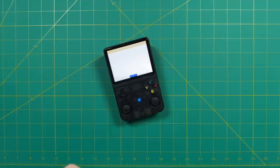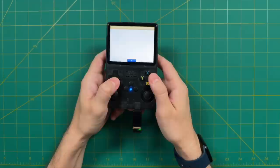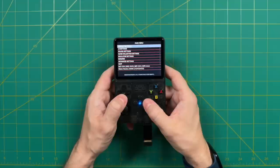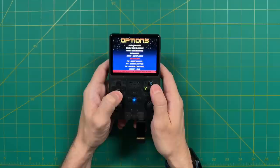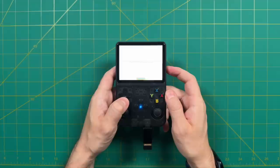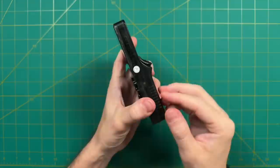I do have a USB Wi-Fi dongle which has worked with ArcOS previously, so I plugged it into a USB-C adapter and tried scanning again — sure enough, it showed a bunch of my networks including my own, and I was able to insert my password and get connected. However, once I left the menu, I was not able to actually maintain a Wi-Fi connection at all. I think it may be a power issue with the OTG port — it initializes the USB dongle at first and then just cuts it off after a moment. As a result, unfortunately I was not able to update the operating system over Wi-Fi.